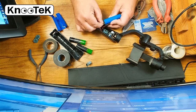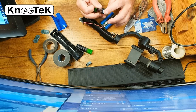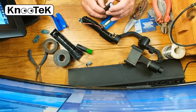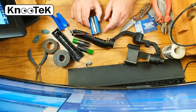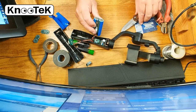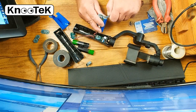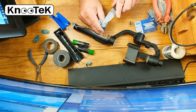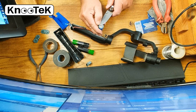I'm hoping soldering will be straightforward. You can buy these batteries with flat tops just like this. These are bigger batteries so I went for these ones, but they've got modules on top which might make soldering a bit harder. They tinned up and soldered okay though. What I've got to do now is remove the connector tabs from the old batteries. You should be able to prise them off, or use a screwdriver underneath.